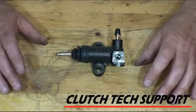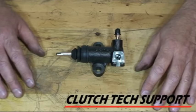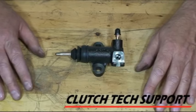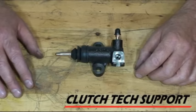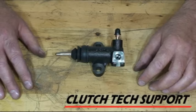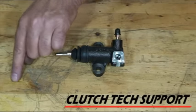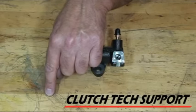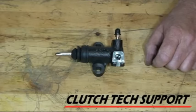Let's set the scene. We're working on a Honda Civic or one of the earlier Nissan 300ZXs, both of which I've worked on and had somewhat similar setups where the master cylinder is on the driver's side on the firewall, but the slave cylinder is all the way across the firewall, goes down across the front of the engine, comes back and hooks in. So you've got this long line going to a slave cylinder.